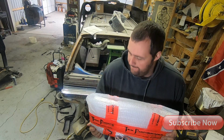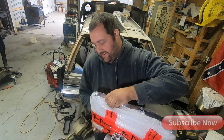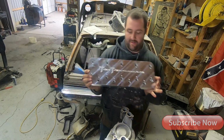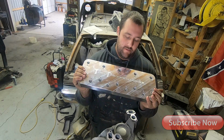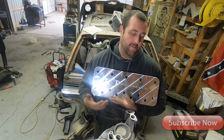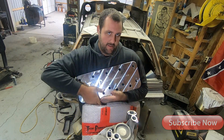So I've had this out before, but it was quite a pain to get back in. A lot of you guys that are into LS cars probably know what it is already, but this is a 1/2-inch head stud plate fixture to do the 1/2-inch head stud drilling on your own. Nobody around me does the 1/2-inch stuff. I've called around, and I'd basically be having to travel to Detroit to get it done, and it was $300 to have it done.